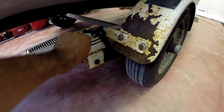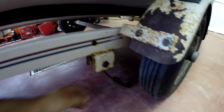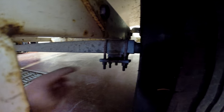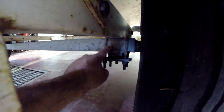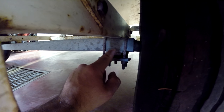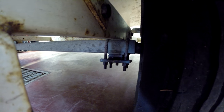The biggest problem may be the rust on the bolts. I just had this kind of hooked up here so I could drive a little bit. You don't want to drive very far when this happens because the trailer is riding right on the axle. When I looked in there I saw an old rusty broken plate — I must have cracked the bottom one at some point. Once it fell out over some bumps, the top one cracked and broke right off. This cross member here — the trailer is sitting right on it. Normally it's supposed to hover above that. You don't want to drive too far like that because if the other side breaks, your wheel and axle are free-floating from the trailer and can swing back and cause a lot of damage.